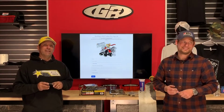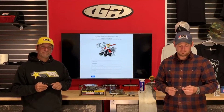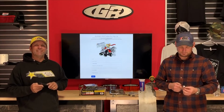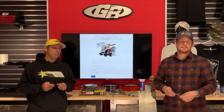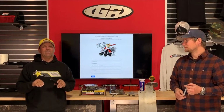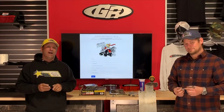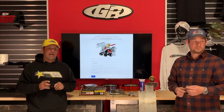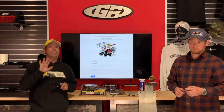We've got a couple of questions. Bill Witten asks, what stall converter do you usually run? Bill, excellent question. Now you're talking my language. What I run is 4,000. And by the way, that's not like you rev it up to 4,000 and dump the clutch. It engages before that. Everybody else tries to run 2,500, 3,000. It's not enough. You need a higher stall. And in the race cars, we run 5,000.